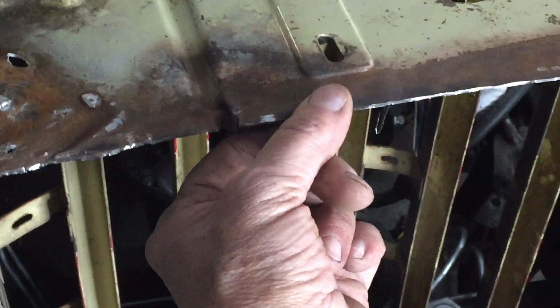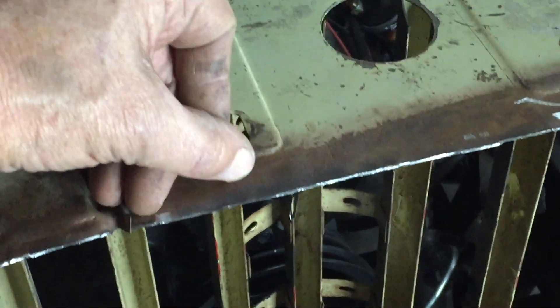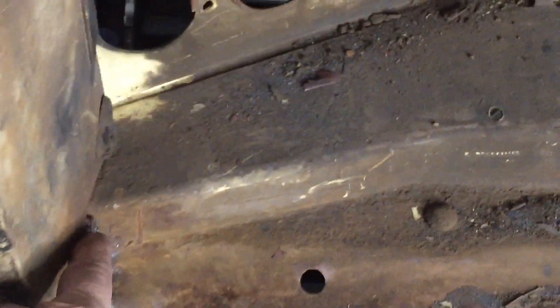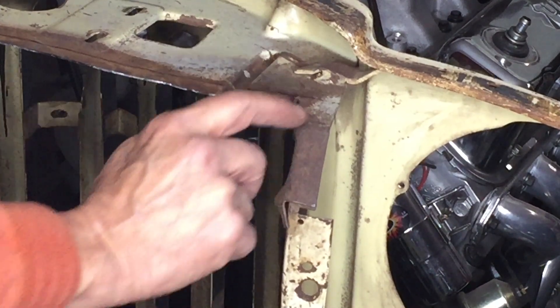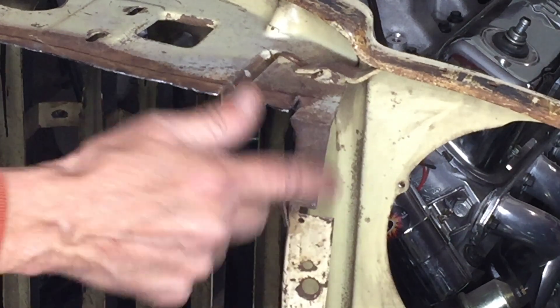What I'll end up doing most likely is bending this over, keeping about a quarter of an inch away from this edge, bringing it straight down, and cleaning it up. That would stiffen this area up too to keep it from flexing when the hood is shut and going down the road. Then I'll decide where I'm going to cut these panels, and once I get down to here I'll just cut straight across. I need to clean this edge off too - it looks like it's spot welded on, so I'll find those spot welds, grind them out, and get this top piece off.